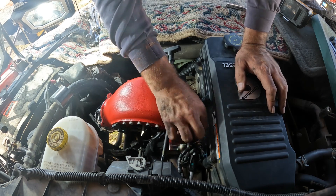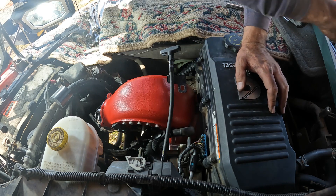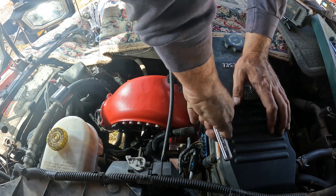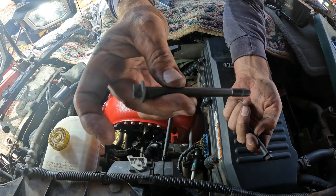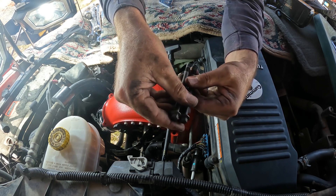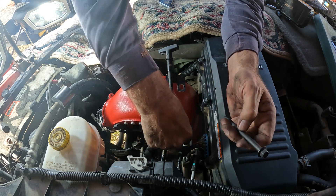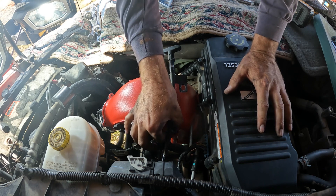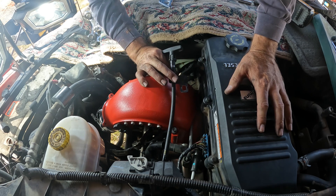I just can't get to this bolt right down there without taking that off. We're going to take that off and hopefully get on this bolt. So Glacier sends an extra bolt and you use the old one — they're basically the exact same bolt. One goes here, one goes here. It's a good idea to leave the whole thing loose until you get them all kind of threaded up just to make sure they all line up.